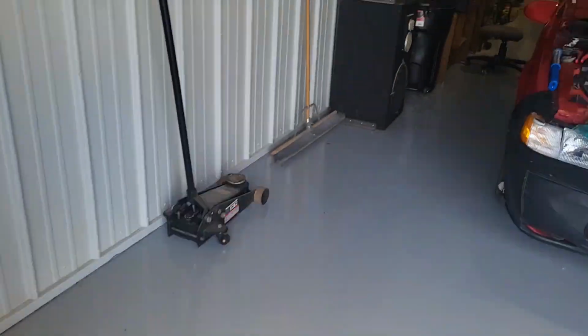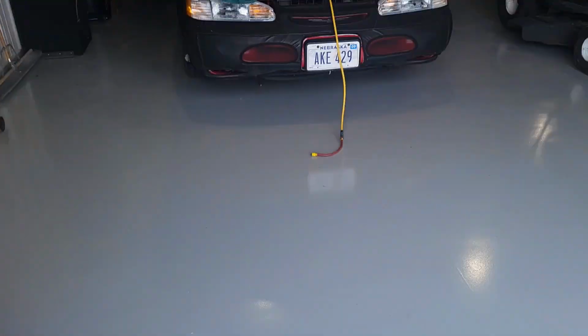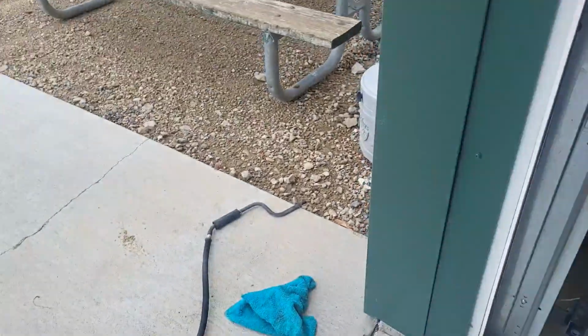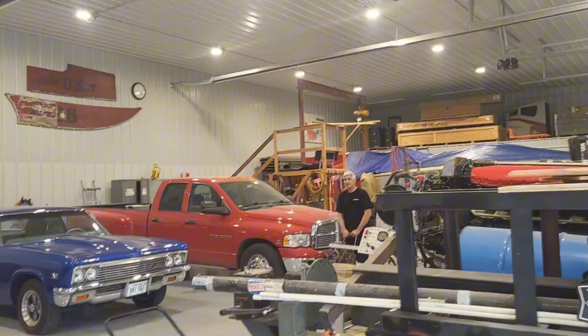All right. We found... Let me turn this dumb music off. All right. We found our problem. This hose is clogged. So he's grabbing something to just flush that out, throw it back in, and then we'll need to go grab some Freon.